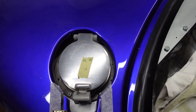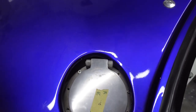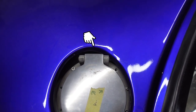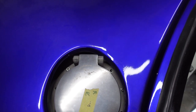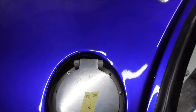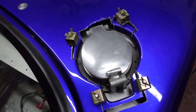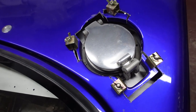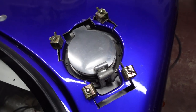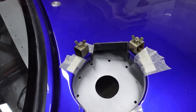Around the remainder of the cap I'll cut a slice and bend it in so it follows the contour of the flap better. It's nice and tight on the right-hand side so that'll remain as is. On the hinge line I'll cut in and form the shape I need to create that squared edge around the hinge profile. What I can do now is put up some formwork around the edges and start laying up some fiberglass.